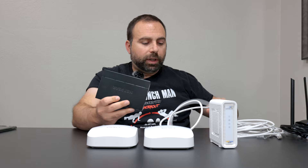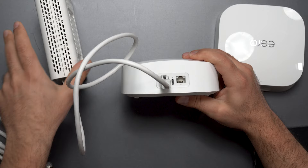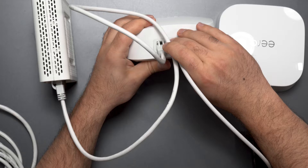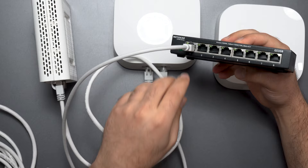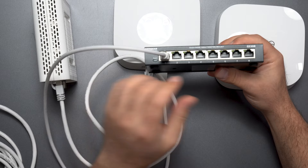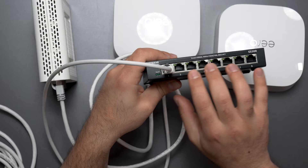In the case of the Eero, because we're going out of gigabit speeds through this port, it doesn't matter if I use Cat7 anymore because the port itself is limited to gigabit speeds. So I use another Ethernet cable and plug it into any port on the switch — port 1, port 6, port 8, it doesn't matter. I personally like to use the edge one, either port 1 or port 8, just so I know which one is connected to my router. When you get an 8-port switch, you have 7 usable ports.